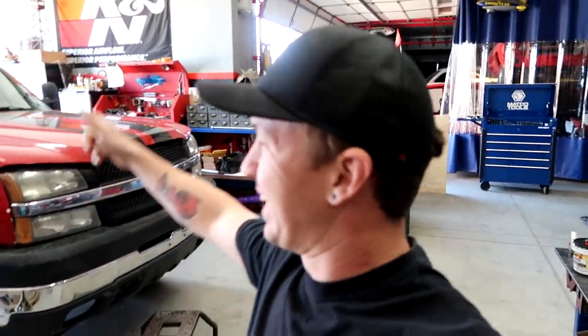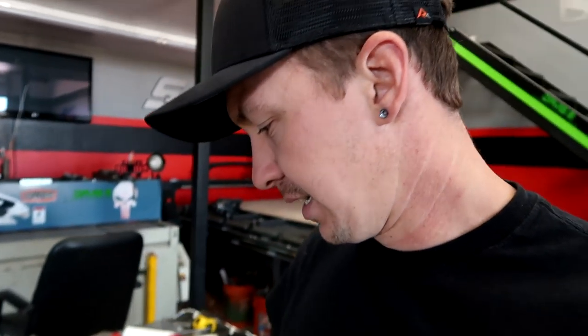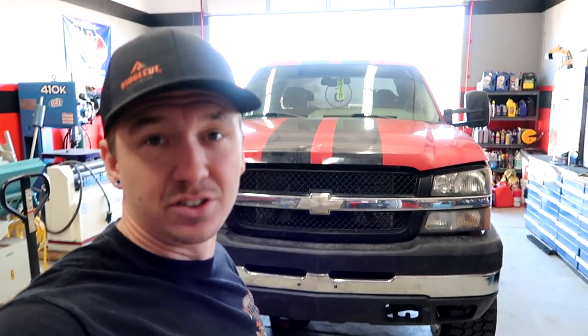Good morning everybody, we are back at the shop again. We got our shop manager — she's yelling at me telling me I'm not getting this thing done fast enough — so we're gonna put some work on this today. Basically I went and picked up the little injector o-rings, so we're gonna throw these on, throw the upper valve cover on, get them torqued. I got a crow's foot here to torque the lines down, so we have everything we need to get this side back together. We're gonna pull the CP3 pump out, get it all prepped and ready so that way when the new one shows up we can swap it in and be done with it. Just gonna keep hammering away at this — get the valve cover RTV'd on, new lines in, all that good stuff.